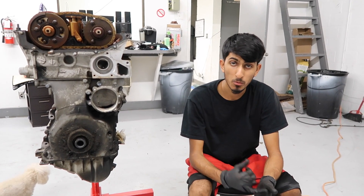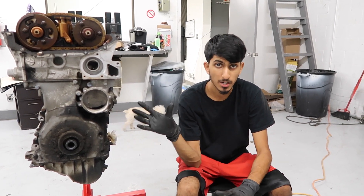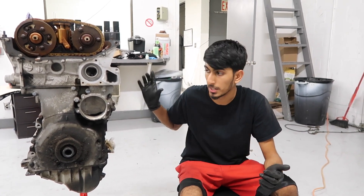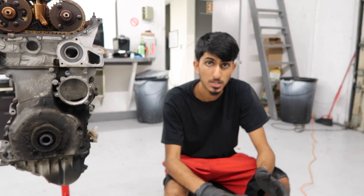Alright, that's it for today's video guys. We went ahead and removed the valve cover, the ignition coils, the ignition coil harness, the vanos, the various sensors around the engine, brackets, and the crank pulley. Someone was wondering how I was going to remove that crank pulley — when it's in the car it's very difficult because it's on so tight, and out of the car there's nothing giving resistance for a breaker bar. They make a special tool called a crank pulley holder that holds the crankshaft while you loosen the bolt. But the easiest way is using an impact. If a half-inch impact won't get it, they also make three-quarter inch impacts. It's a 22mm bolt, so get an impact socket — even with a large breaker bar, use an impact socket so you don't break your regular sockets.